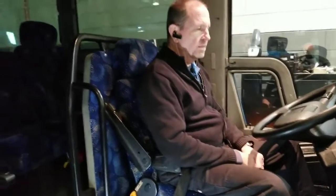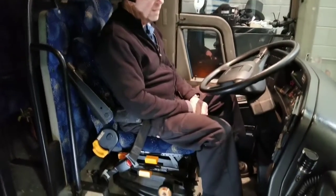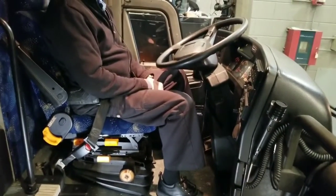You want to make sure that you don't lose more than three PSI. The first minute is up. Now I'm going to place my foot on the brake pedal, push down like I would at a stop light, and make sure after the initial drop, I don't lose more than three PSI.